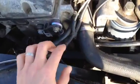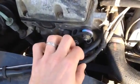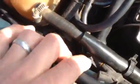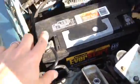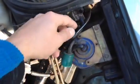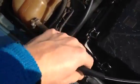What I did first is I basically just kept all this intact. A lot of people cut it off here or block it off right here, but I kept it intact and ran the line all the way around, then I bypassed this connector right here that goes into all the rat's nest. Basically this line just stays in line and goes all the way around to the vacuum reservoir and then back around to what they call in the forums the blue flying saucer. I just kept it tight in — all I did was bypass it right here of all this vacuum stuff.